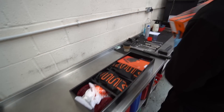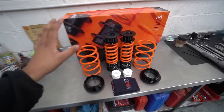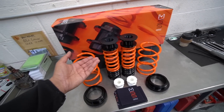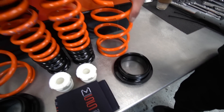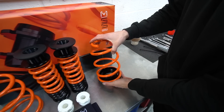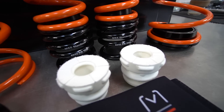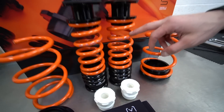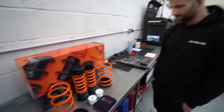You're getting all the valuable market information today rather than just a shiny collection video. So we've got the goods — MSS. I've gone for something a bit different this time. Usually I've always done the MSS Sport Kit, but this is a track version — the spring rates are a bit different. It's not just lowering springs; we've got the adjusters so you can adjust your ride height accordingly. On the rear these are different to the BMW setup — you've still got a three spring rate on the rear stack. Installation is pretty straightforward, you just have to account for the adjuster.